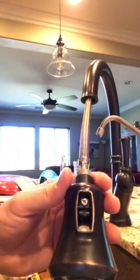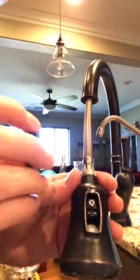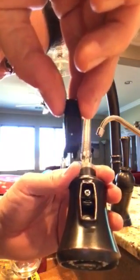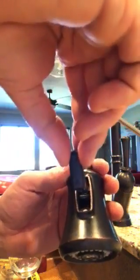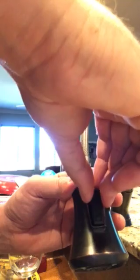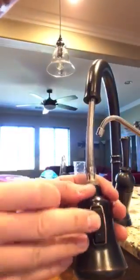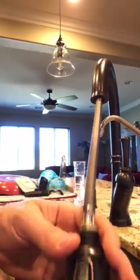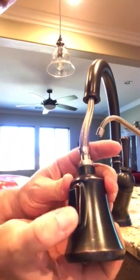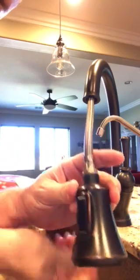And then you put your toggle switch back on, and that goes with these little forks down because it has to grab that plunger. So make sure when you put it in at an angle so it goes behind the head of the plunger and grabs it because it has to push it in and out. Then you just snap it on and it's on that fulcrum, and you have a part that actually works again just with one thumb, and you can just push on it and it works much better.